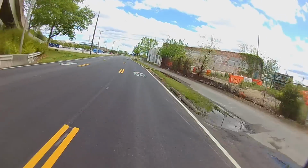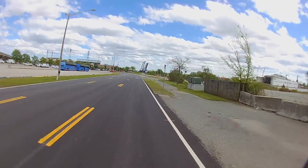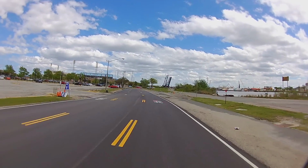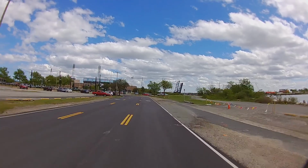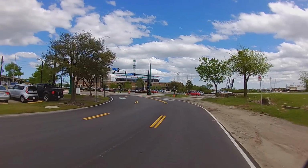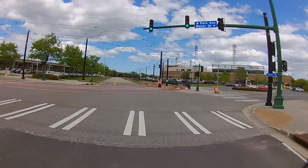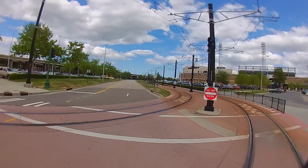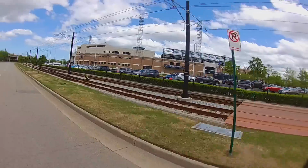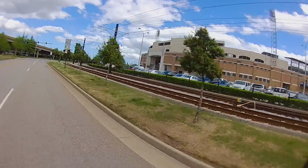As you're seeing right now, I'm doing a speed run, and I've got the GPS going, and I'm happy to report that I hit 47.2 miles per hour. But I've had the bike over 50. If I barely retard the timing, I can get this thing over 50 easy, but it becomes kind of a turtle off the line. Similarly, if I advance the timing, this thing flies off the line, but then tops out around 40 or 42 miles per hour. And what you're looking at is a happy medium.